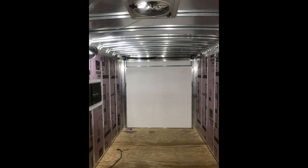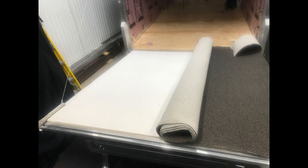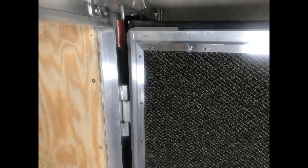The finished interior is carpeted on the inside — it's an interior wall for the most part. I don't drive four-wheelers or muddy things on it, so in this case the carpet is a pretty good value: very inexpensive, easy to apply and replace. I wrapped the whole edge of all the wood with three-quarter-inch, eighth-inch thick aluminum angle stock. Everything was pre-drilled before the carpet was put on — I fit all the aluminum first, then installed it after the carpet was on using an ice pick.